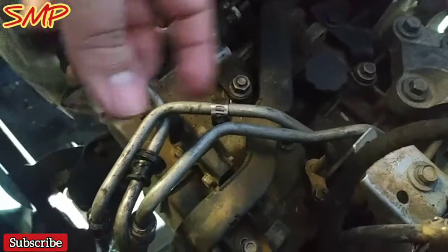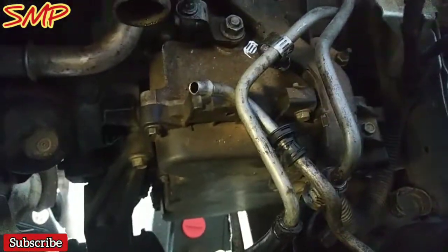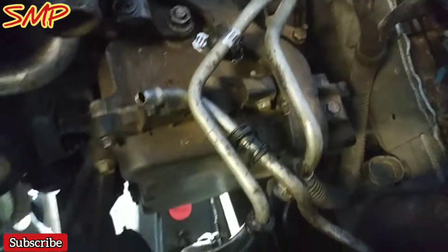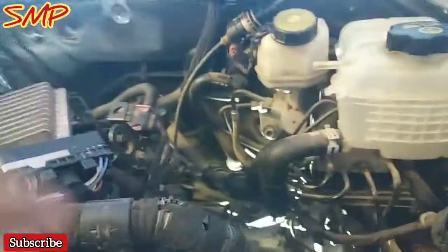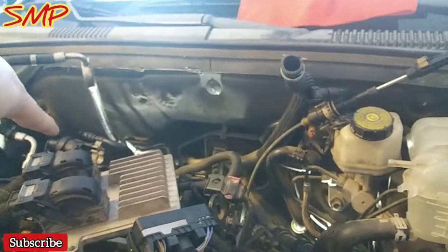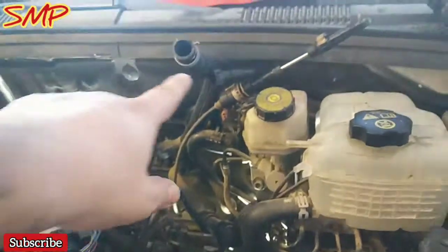So here's one. It has those butt clips or wedge clips that just sleeve over. So you'll need a pick to punch those out, and they fling. So I'm gonna look for one. I have a packet of them because when I'm doing my LS swaps, it's very common to disconnect all these. So radiator hoses all off. Like I said, everything, emissions lines. I had one up here for the evap, one back here for the manifold. So that's that one right here.